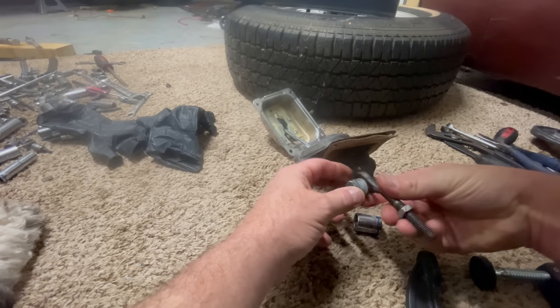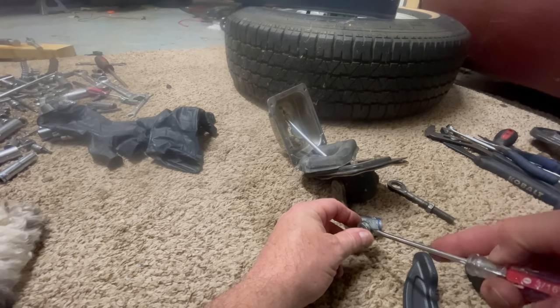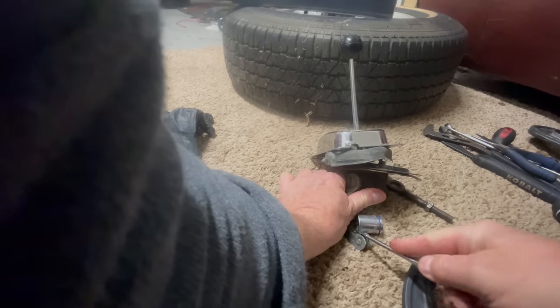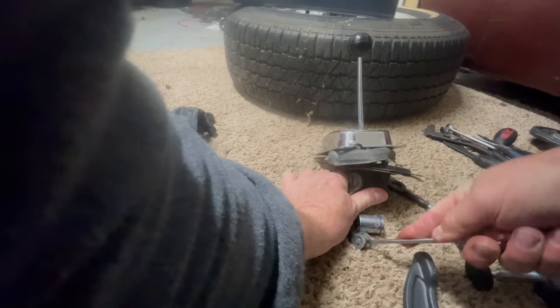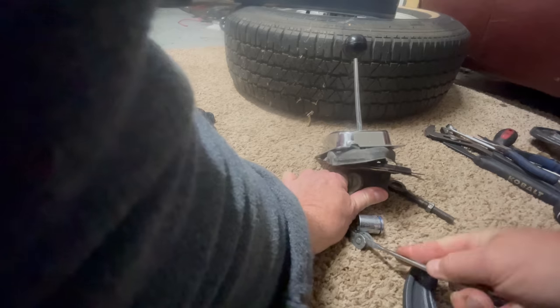So then I had a bright idea. Why don't we do what everybody tells you not to do? We put the bushing onto the shift lever first, and then I was going to squeeze the ball socket into that using some pliers. Guess what? It worked. It worked great.